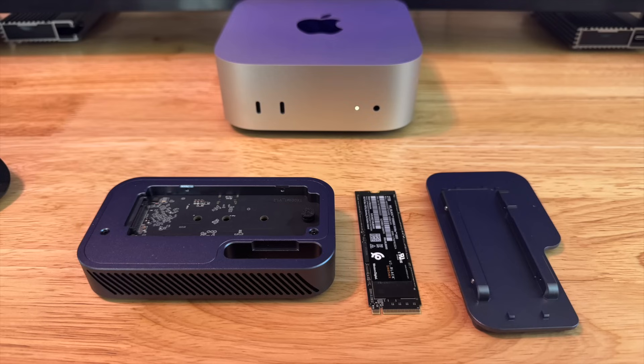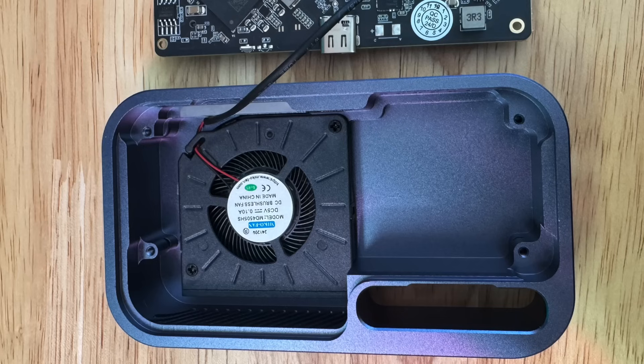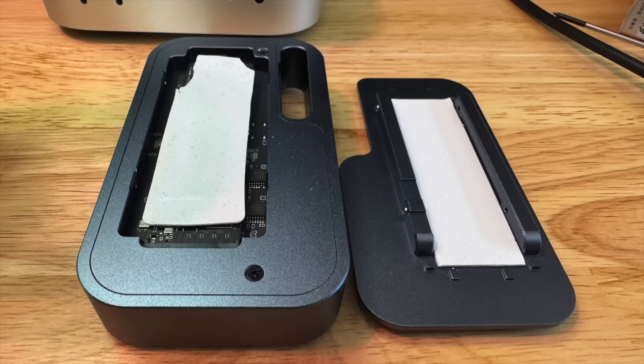We'll just insert our NVMe. You don't need any tools — just flip it over and open up the bottom of the case, grab it with your thumb and lift up. I added rubber bumpers because it keeps the unit from sliding around on your desk and gives a little more air circulation for the fan. This unit does have a built-in fan. NVMes run quite hot, especially when you're really pushing them, so it's good to have the fan — it's not adjustable, it's just on. They give you two thermal pads: a thin one and a thicker one. I put the thick one on the door cover and the thin one on the NVMe.